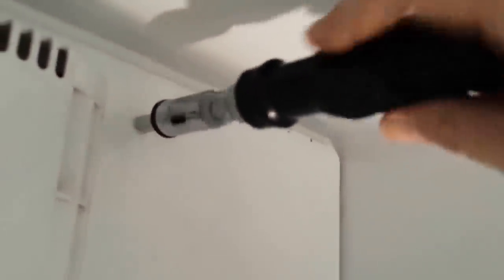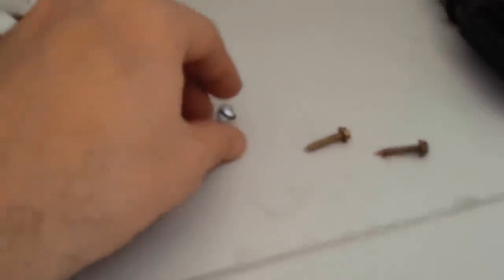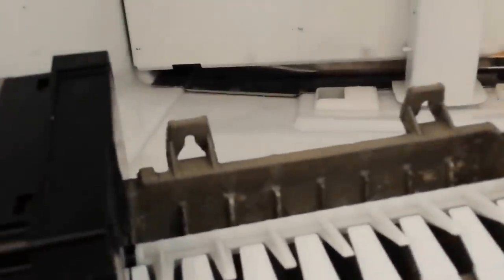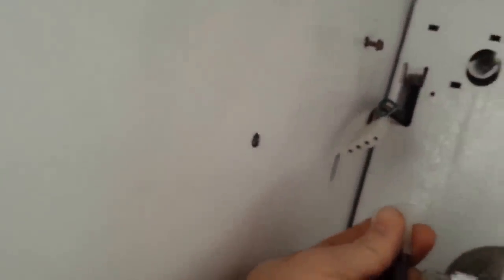Get this reattached. Now the ice maker — on my unit there were two gold sheet metal screws and one silver sheet metal screw. What you can do is start those screws in your holes and they'll kind of drop through so you can hang the ice maker on them. I got the screws inserted. When you're putting this clip back together, it's form-fit, meaning it's only going to go one way. The trick is just making sure you can see the hole right here — that's where the spout for the water comes in to fill up the trays. Then on the bottom is the hole for the other screw, so just tighten things up.